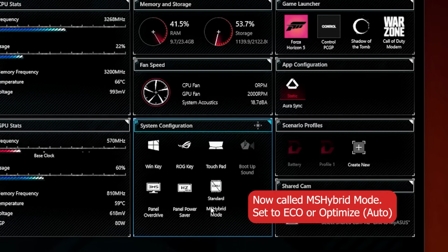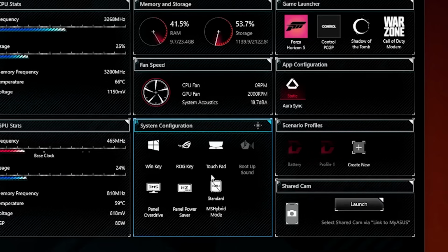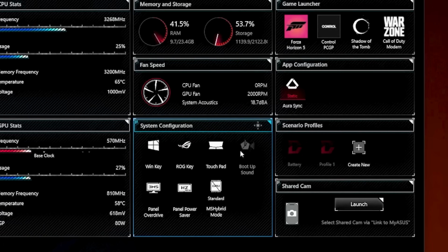That way you're not using your RTX 3070 or 3080 whenever you're just trying to do basic tasks. I mean, even some heavier duty things will run fine on AMD Radeon graphics, so I wouldn't worry too much about it, especially when you're on battery and trying to maximize battery life. Radeon graphics can handle a lot of stuff really well, actually. So those two settings alone will probably grant you 8 to 10 hours right there.